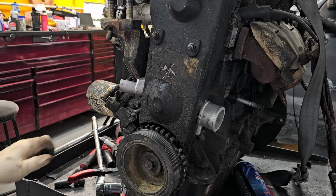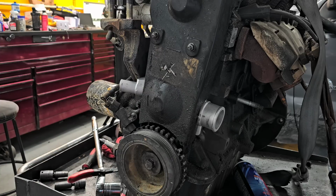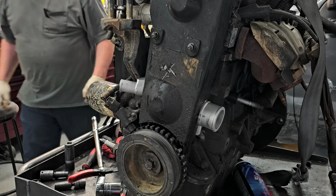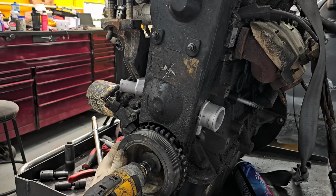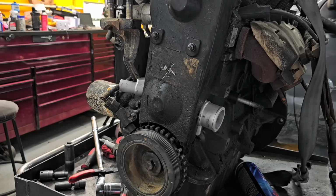And I'm actually gonna use this gun, because I don't know, the 1/2-inch gun is kind of strong. The head of that bolt is a 3/4 or a 19 millimeter. So let's just get a 19 and we'll tighten that down. The reason I said 3/4 or a 19 is because I actually don't have a 3/4 and a 3/8 drive here. I have one at home, but not at the shop. And that's it. Good and tight. So that's pretty much it for that. So I'm good. I'm happy with that.